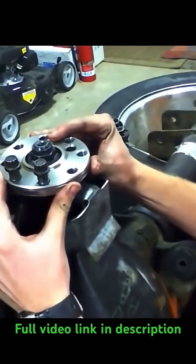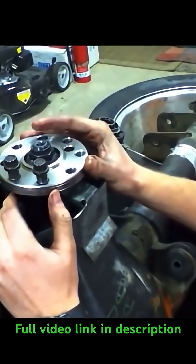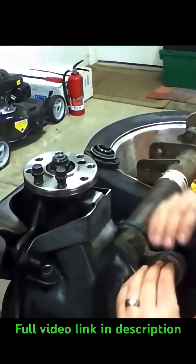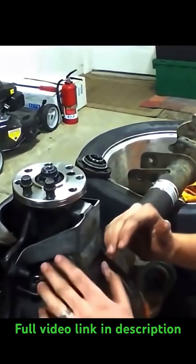There's a little bit of slop left in it — just keep tightening it down until you're crushing that crush sleeve. We're gonna do this up until we have about 20 inch pounds of rotational drag or preload, which I'll show you here.